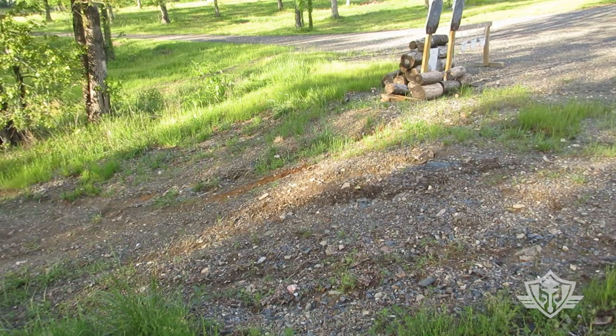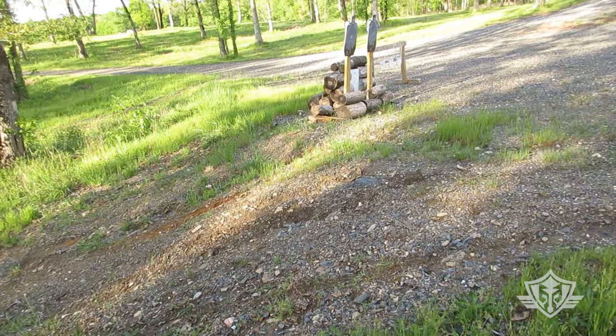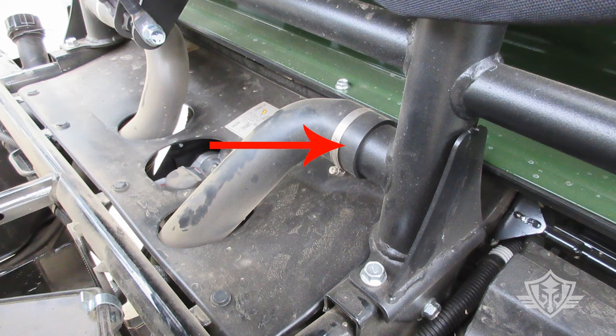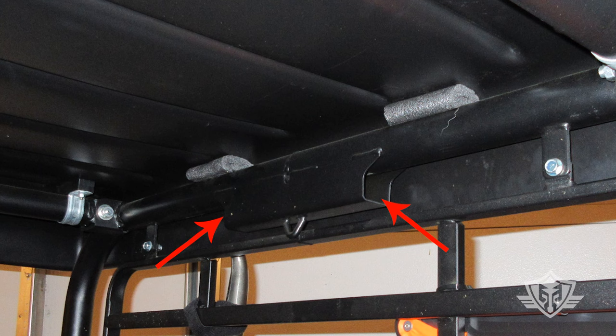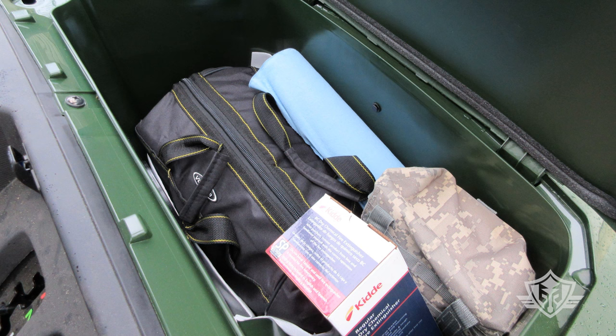Just remember to disengage the four-wheel drive on paved roads. As I understand it, the front diff has an ever so slightly higher gear ratio than the rear. This helps the Mule to kind of pull itself up steep and loose terrain by spinning the front wheels slightly faster than the rear — great for traction and stability in the dirt, but it can cause drivetrain synchronization issues on pavement. I also love the built-in snorkel on the air intake. They integrated the roll bar tubing to make the air intake as high as possible, which means the air filter stays cleaner for much longer, as it doesn't suck in the dust kicked up by the wheels below. This is absolutely brilliant design work by Kawasaki.